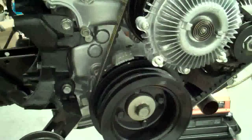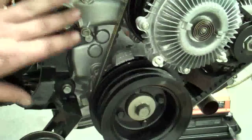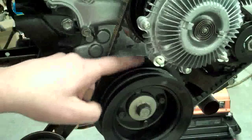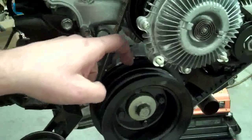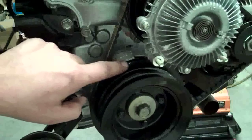Here's a neat little trick on how to set up your distributor for number one TDC. When we ship the engine, it's basically in the number one spot. After you install your pulley, you're going to find the groove in there, put a little bit of liquid paper, something white, anything to make a contrast.